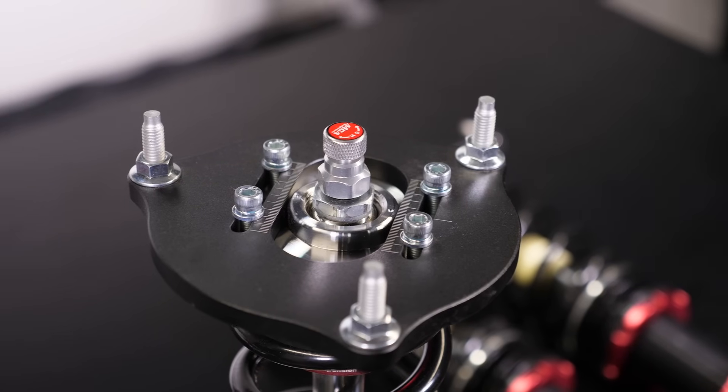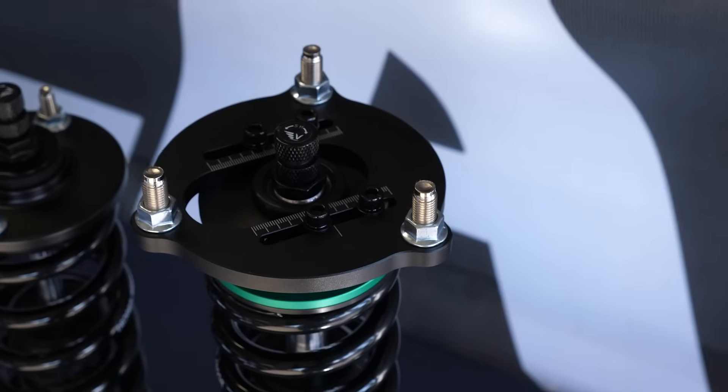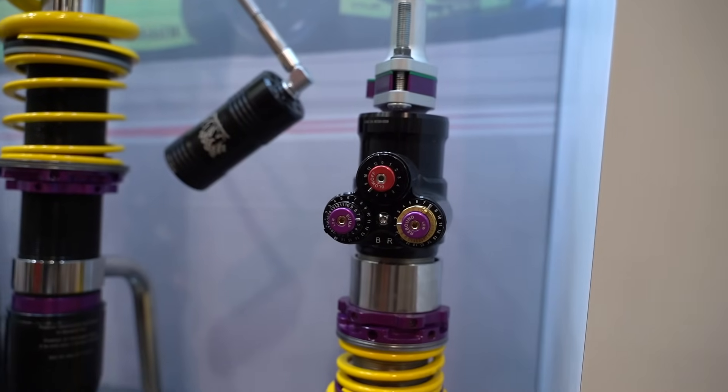Every object has six degrees of freedom: up, down, left, right, pitch and so on. In the rear geometry of this car, the wheel is allowed to move in one direction — up and down — with control arms stopping movement in other directions. With the McPherson strut, it has to handle two: the steering aspect and the up and down aspect. So there's a lot more load going into a McPherson strut damper than in the rear damper. At the entry level you might have a one-way adjustable damper, then independently adjustable bump and rebound, and in racing shocks perhaps four or five-way adjustable with high and low speed and blow-off valves for running curbs.